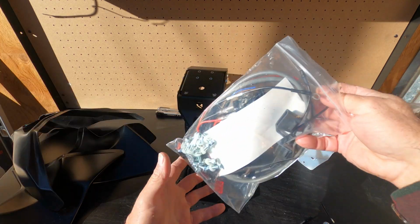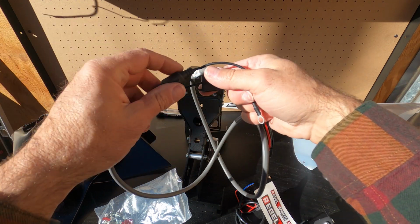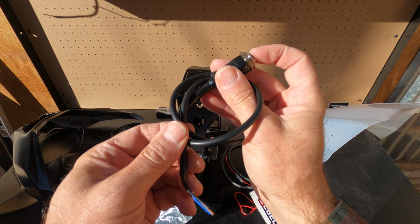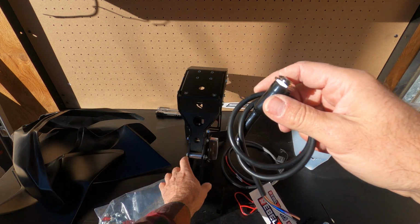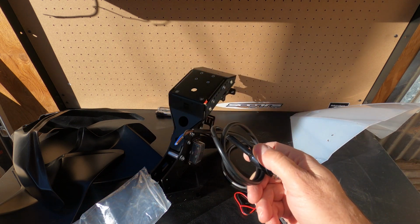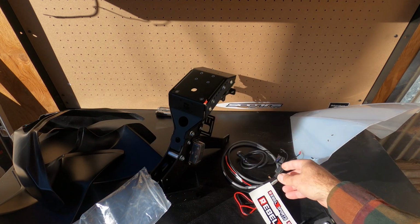Okay, back to the electronics that come with the kit. Not a lot of stuff. It's just basically your battery connection with a 10 amp fuse holder built into it. There's that. It comes with this little on-off button, and the idea behind providing this is you can turn power onto your tower, power into that fuse box, or off, so you don't accidentally leave something on that burns your battery up. The PDM shuts itself off, so I don't need this. Actually, this is a really nice switch. I'm going to use this switch for something.